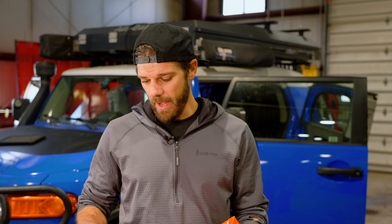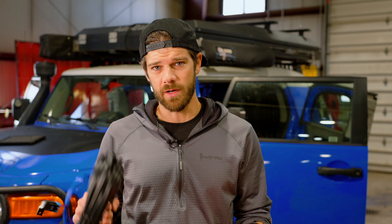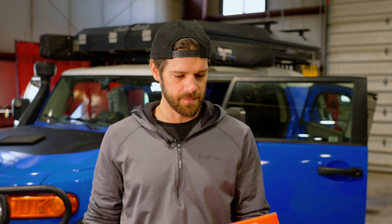All you need is an allen wrench. I actually helped Redarc a little bit with this a couple years ago as they were developing these systems, so it's cool that they sent me one to try out. Today I'm taking my 25 amp charger out of the FJ and putting a 40 amp in. The reason is the 25 amp will keep up for most people, but in my situation I'm charging a drone that takes 10 amps and all sorts of camera equipment.